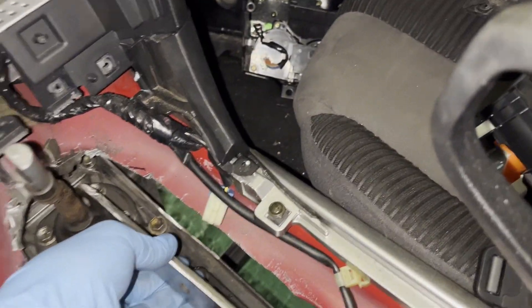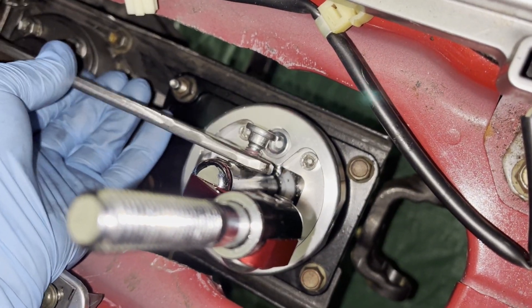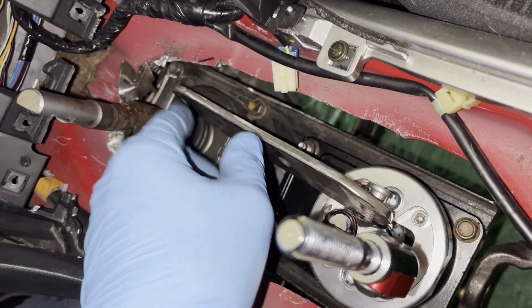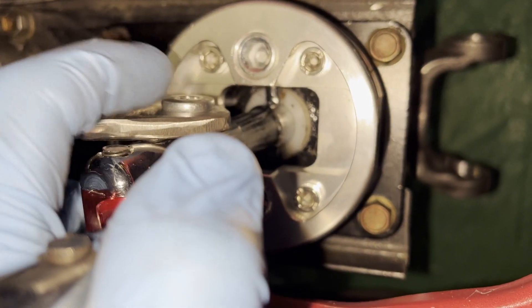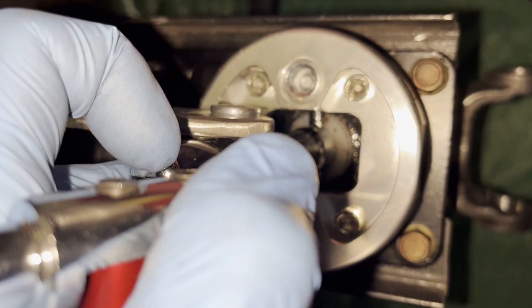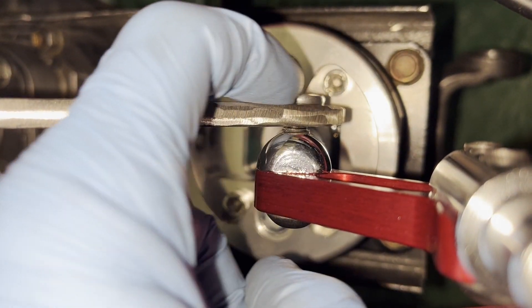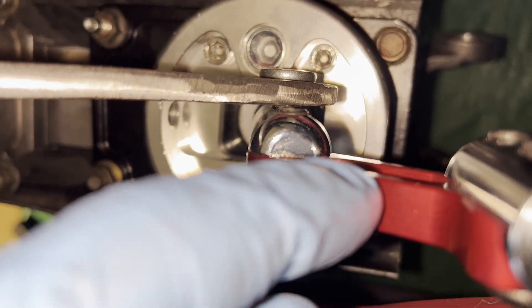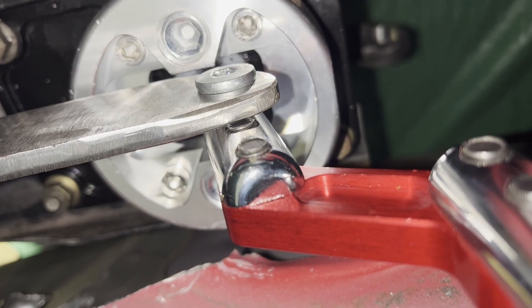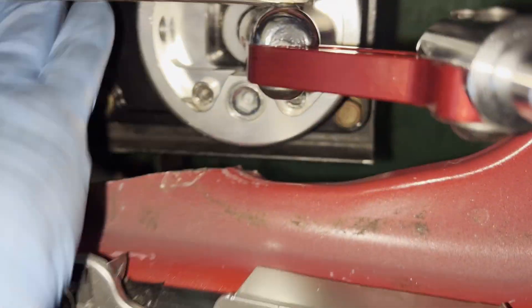I have the linkage made up roughly. I'm going to put my bolt in here and see how well it pivots in my shifter back here, and if it's looking good I'll take the shifter out, drill a hole in it, and get another bolt for it. So I have this bolt tightened down and it's binding up a little bit. The bolt has a shoulder so I can tighten it all the way down and the linkage still has enough clearance to pivot. I need to take a little bit off to reduce the thickness, and also there's a bolt from the shifter itself that's sticking out and rubbing — I need to shave that down flush.